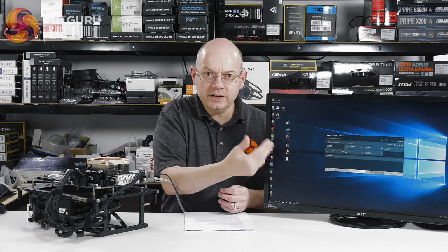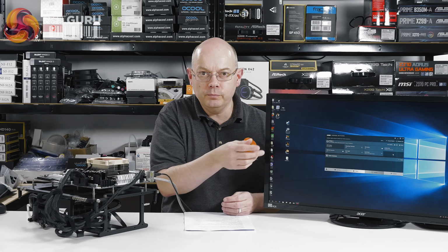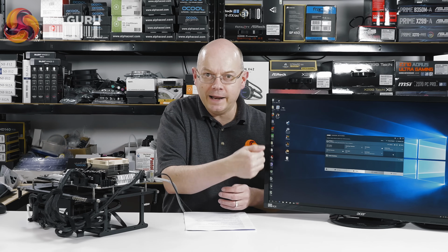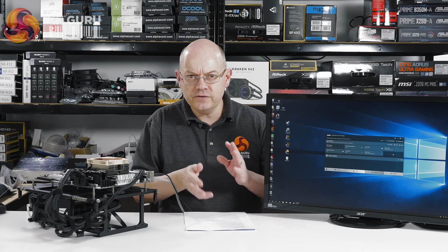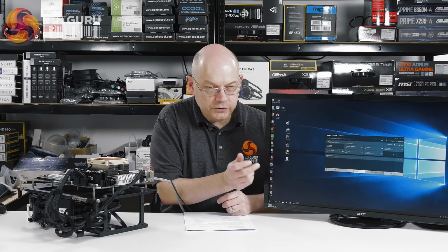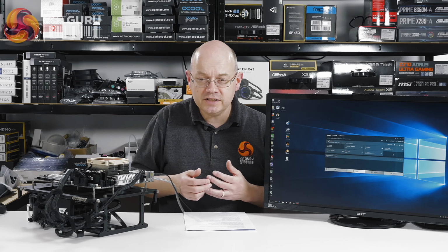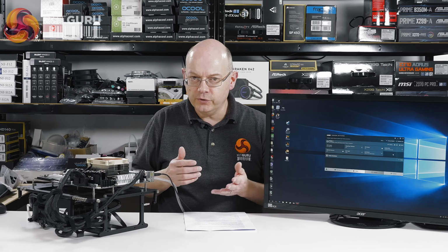This is an effect you actually get on televisions. You're just not aware of it because on TVs you don't have icons. The fact you lose a few mil off the edge of the screen just means you don't get a black border. So this overscanning, underscanning thing is entirely normal, but for Windows it's a problem. So you want it to be bang on, and generally you just drag back the scaling a fraction and everything's happy. With this motherboard, I couldn't do it.